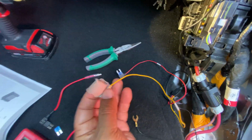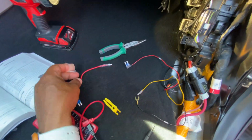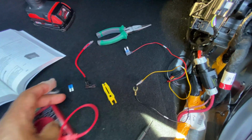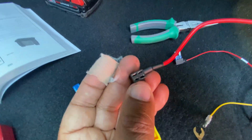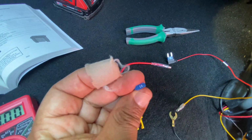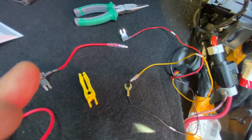Also, that's the yellow wire. So therefore you can use the yellow wire and you're gonna get that fuse tap, connect those two. Remember that fuse that comes out of there at number 30 will go on the bottom. And the fuse that they give you, which is the number 15, will go on the top. So I'm gonna get that going and get that installed.